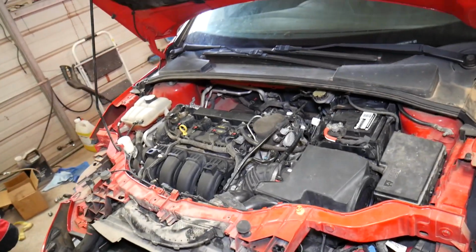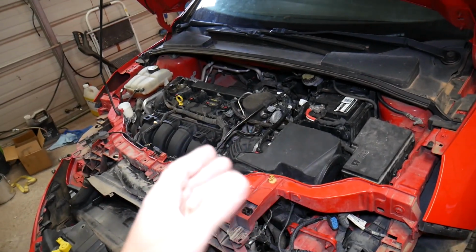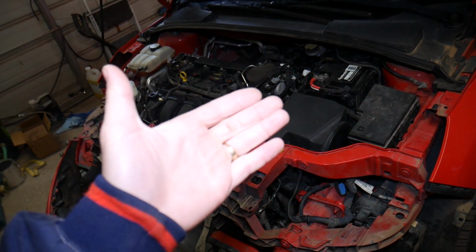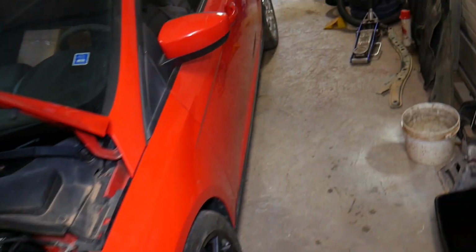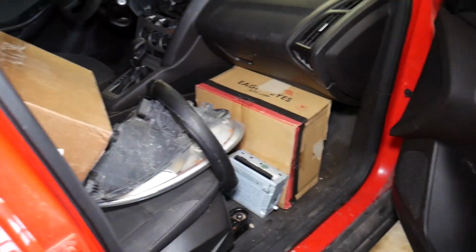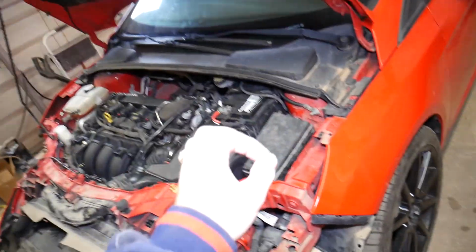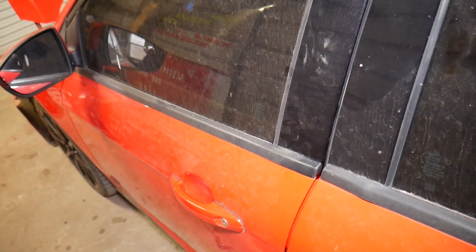Now, some cars have a fuel reset switch, and if you replace the engine, sometimes that switch will be activated. On some models, let's say some older Fords, they used to have a fuel reset switch. Just search for your specific model, not everyone has it, but some Fords used to have it. It used to be right here or in the trunk and you have to press that switch in to be able to start the car. Otherwise, it wasn't possible to start the car until you reset the fuel switch. Another thing, if you don't have that fuel reset switch, new vehicles now have it integrated in the ignition switch, and I'm going to explain about that in just a second.